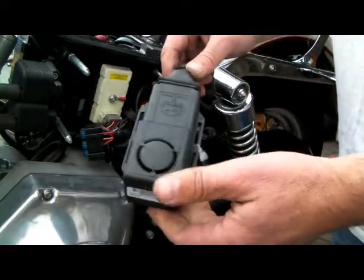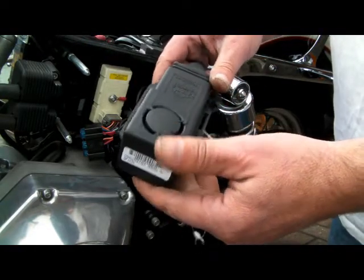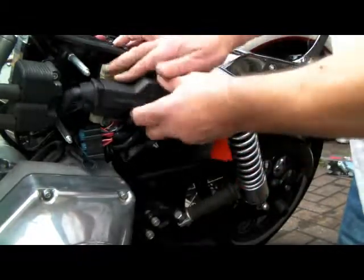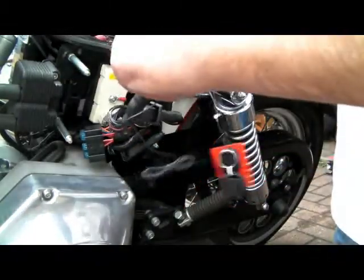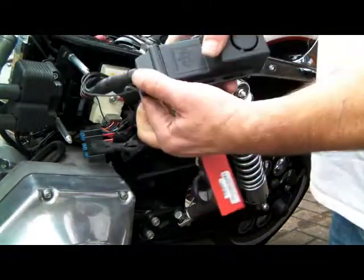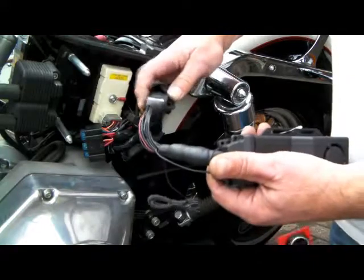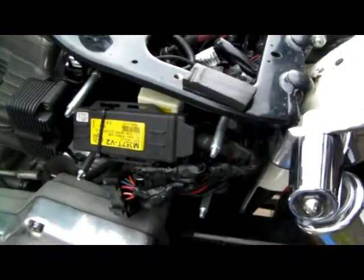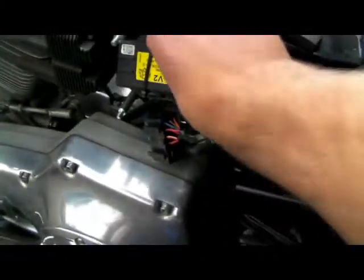Now to test it — turn the ignition on, then off. That'll wake up the alarm from sleep mode. Test all the functions of the alarm to make sure the bike starts, and when you're happy with that, put it back the way it was. We'll put a few straps in — don't forget to put the covers back on. I strongly recommend cutting the rubber bung away here and wrapping the supplied insulating tape around that joint. The TV2 is nicely fitted — it's strapped in there so it's nicely held in.